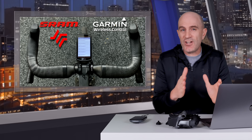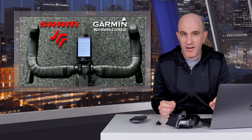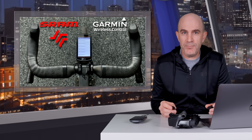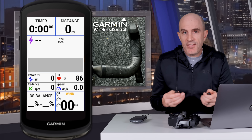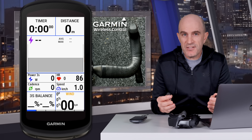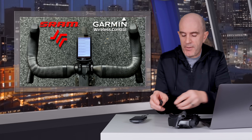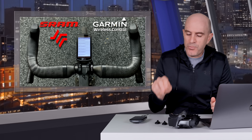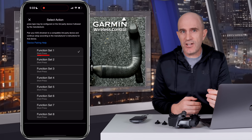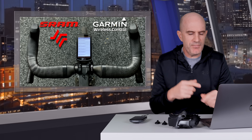Key takeout notes: each button can be configured as either gear control or computer control — you can't do both. The paddle buttons, which are by default gear changes, cannot be assigned to ANT+ shift functionality. The third button is a virtual separate button entirely, which can be configured for either gear or computer control. For example, the dual press could be assigned to shift gears — if you've got a front derailleur, you can assign that double press to a gear shift. Also worth hammering on: wireless blips do not have any long press functionality. The SRAM AXS app confirms this. However, the Karoo 3 and Garmin Edge units believe they do — they don't, it doesn't work, but we are in early days of the implementation.